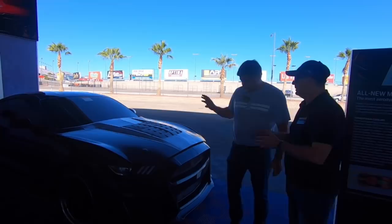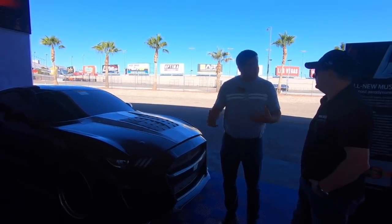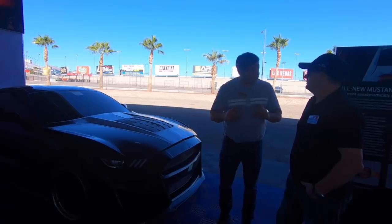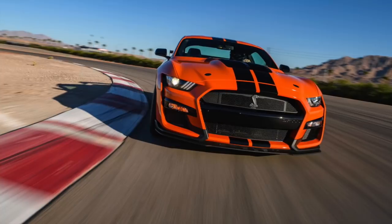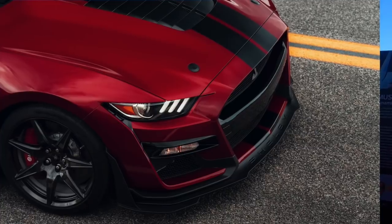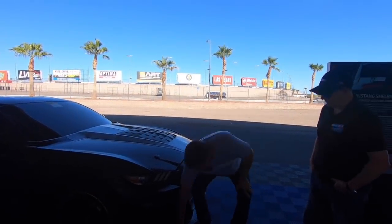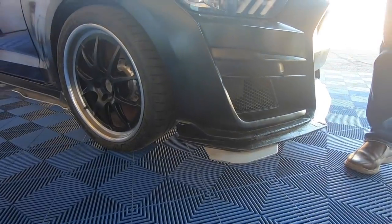This aero buck goes in the wind tunnel — first in Detroit at the slow-speed wind tunnel, then down to Charlotte at the high-speed wind tunnel with the rolling floor. The process starts with a computer graphic showing predicted airflow, then the slow-speed tunnel to verify, then the track, then the high-speed tunnel. From that process you learn adjustments — maybe the splitter wicker needs to be wider or deeper. Before 3D printing you'd have to retool a part and wait weeks; now you can do it overnight.